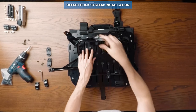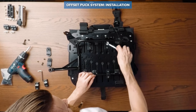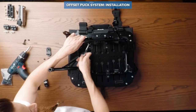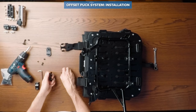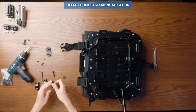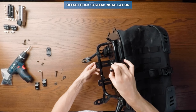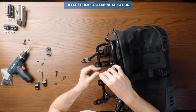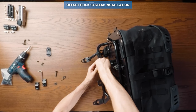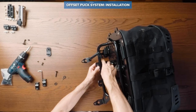Then adjust the height of the offset bracket and tighten the screws. Slide an alignment washer in between the offset bracket and your pannier rack. Then install the longer screws followed by a split lock washer and a regular nut each. Make sure you don't use the lock nuts here as these are dedicated for the C-shaped clamps.